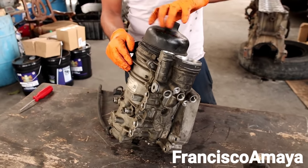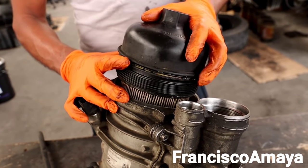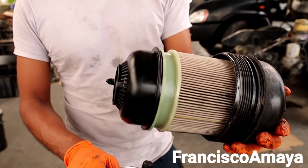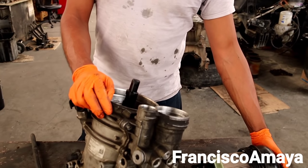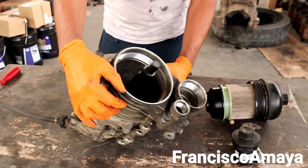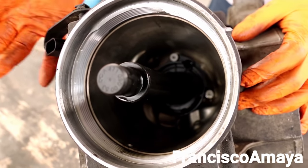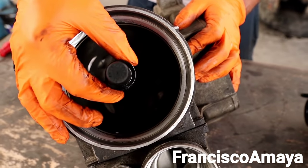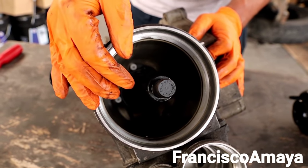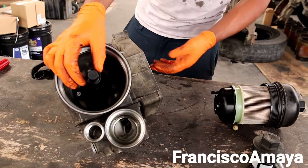We go to the bigger filter. There's nothing special — I'm pretty sure you've already seen how this one looks in real life, because if you've already done an oil change or replaced fuel filters, it's pretty much the same for all DD15s or DD13s regardless of year. After that, we have this plastic bracket where the fuel filter goes — it's just a directional bracket, nothing special. It has no check valve; it is just a straight plastic bracket to keep the filter in position.